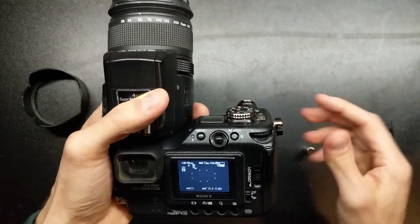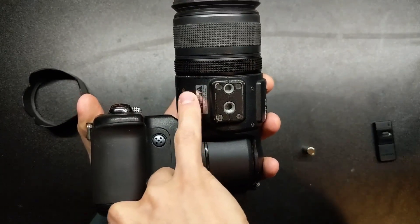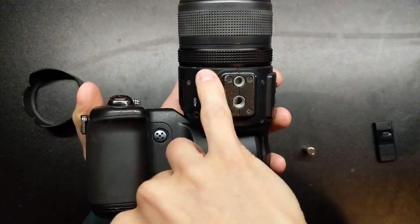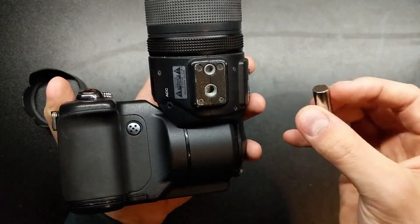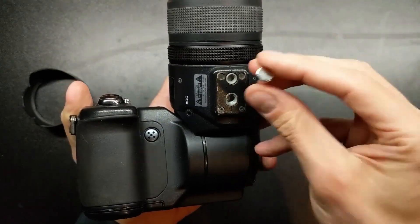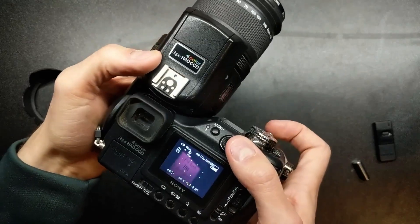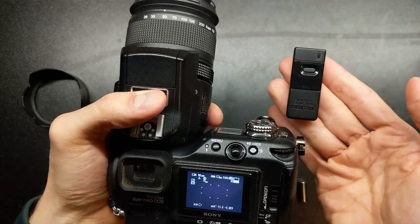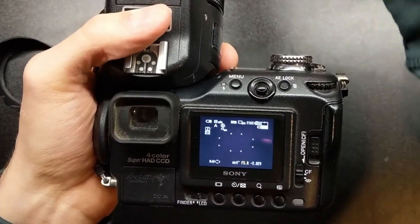To do this I'm going to flip the camera over — this just makes it easier to show you. There's a very specific location on the camera where you need to put your magnet, and doing that will move the hot mirror out of the way. I'll put the link in the description to the one I bought. I'm going to put it right here where my pinky is — that was the wrong side, I'll flip it over. You can hear a very faint click, and there you see — you can see some stuff now whereas before you couldn't. We're in IR. If I take the IR remote and shine it in front of the lens, you can see it much more clearly now.